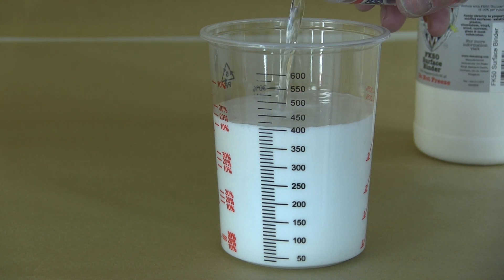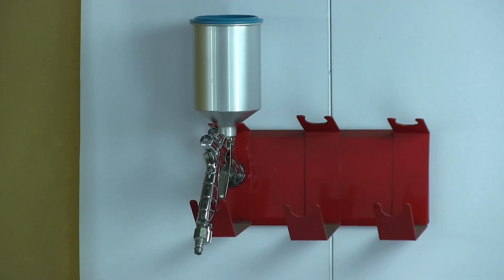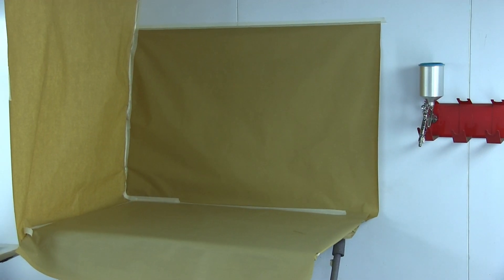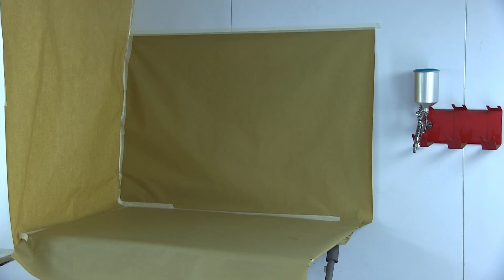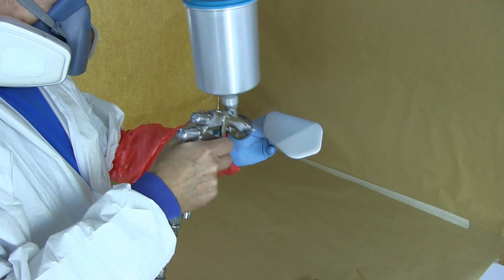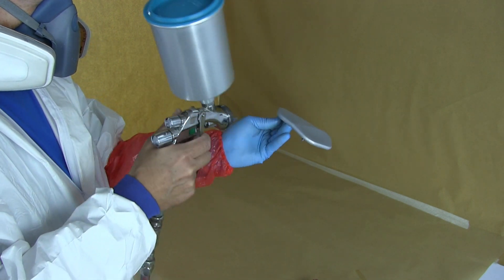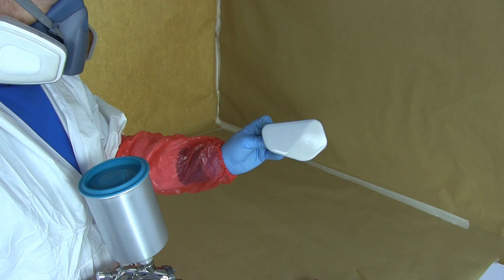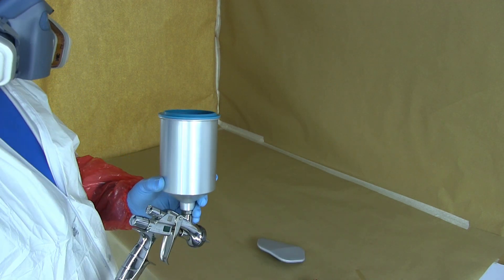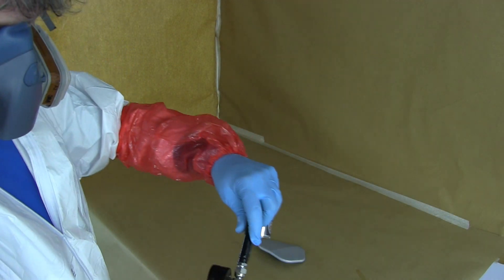So 10% reduction into the FK50, and I'm putting that into my gun now. Before I start to spray, I'm going to make a little canopy — a little area — because with dry flaking I'm going to be able to keep my flake and recycle it. I'm just making this little tent out of paper. I'm putting one coat of FK50, and it needs to be just one coat. I'm using a 1.3 spray gun, and I've just put on a wet coat — no editing here.